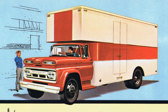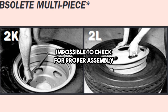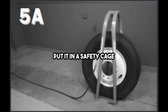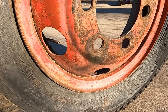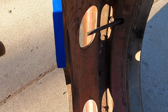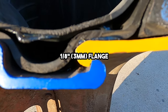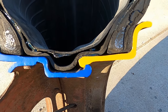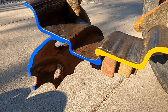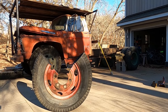The main cause of accidents involving split rims is due to a lack of employee training on safe procedures. However, the RH 5-degree earned the name Widowmaker for a reason — it's the only wheel out of the four mentioned that, once mounted, is impossible to check for proper assembly. The only way to know for sure it's assembled correctly is to put it in a safety cage and air it up. If the wheel explodes, it was not assembled right. This is a 1962 Firestone-style RH 5-degree wheel with a period-correct 20-inch bias-ply tire. The outer ring includes the center of the wheel bolted to the truck, and the tiny 1/8-inch-wide flange where it interlocks with the inner ring is the only thing holding this wheel and its 40,000 pounds of pressure together. You can't see if it's seated properly once a tire is mounted — many people argued this shortcoming was serious enough that the wheel should not have been produced at all.